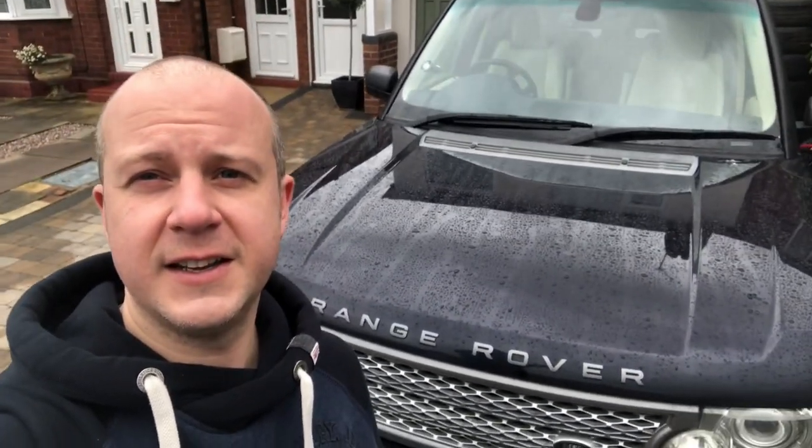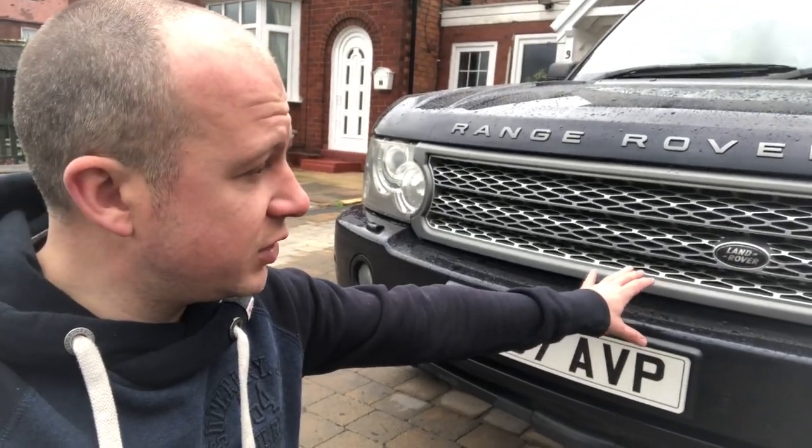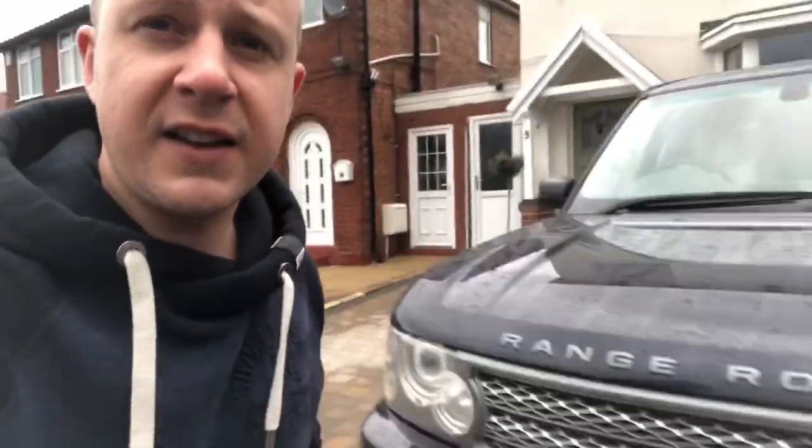So you've decided to go and inspect a vehicle. Today's probably one of the worst kinds of days because it's been chucking it down and the vehicle's wet. It's not ideal viewing a car from a bodywork perspective when it's got rain all over it, but it is what it is. If you've travelled and you've got to look at it, just deal with it. Start at the front — look at the bumper condition, the paintwork, lots of stone chips. Are there any signs of rust? Move around in a clockwise fashion all the way around the vehicle. Don't get too bogged down on anything mechanical at this point — look at bodywork.